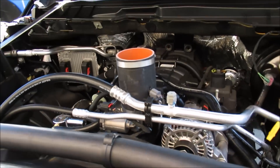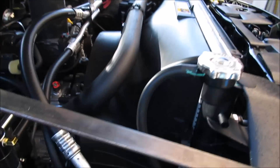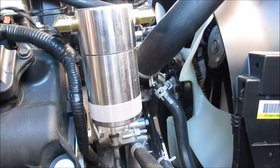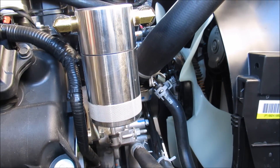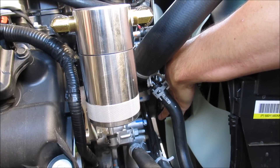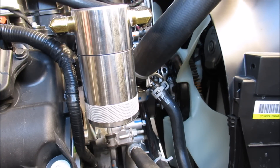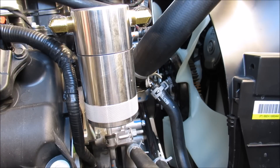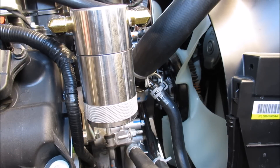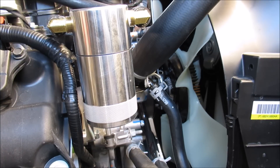I like to use a big crescent wrench — just put a big crescent on the nut and then you're going to use a hammer to hit that crescent to break the nut loose. First we're going to go ahead and put the bolts through the holes in the pulley to hold it in place. Once that's done, you set your crescent wrench on the fan bolt and hit that with a hammer — it should break loose fairly easy.